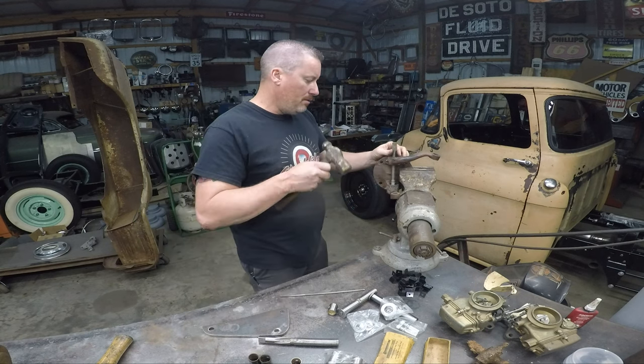I'm going to end up doing it like this. It's going to be a little hard for you guys to see because that steering arm is in the way, but as I push, you can see it's cutting that bronze bushing. I've just got to keep pressure on it as I turn it. You really can't do it without a glove because it will chew your hand up.